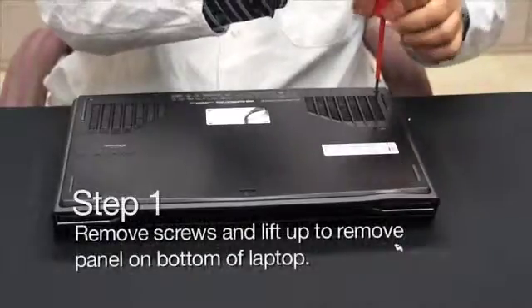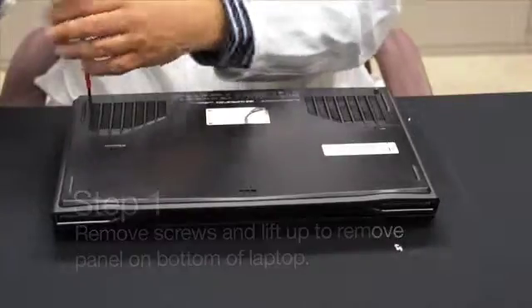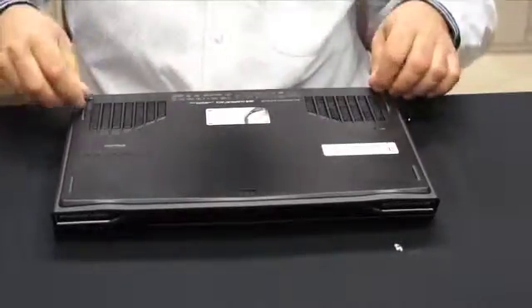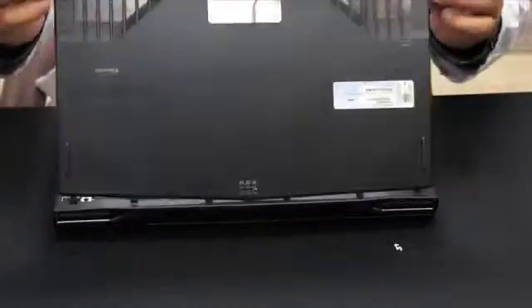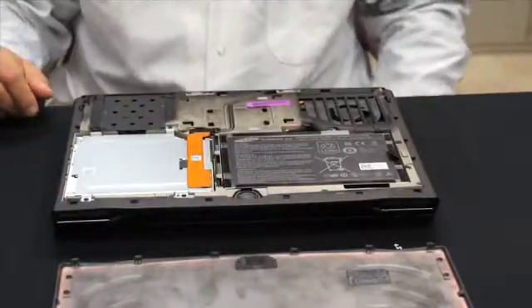So what we are doing now, we are doing some screwing. There are a couple of screw holes on the laptop. In this case, you just pretty much push it back, flip it, and you will gain access to where the memory location is going to be.